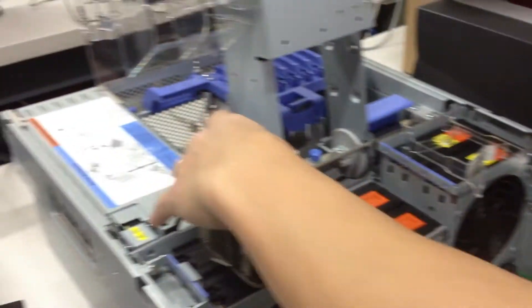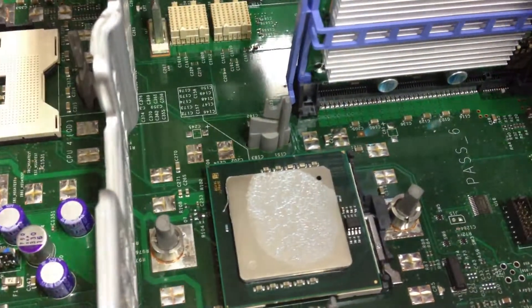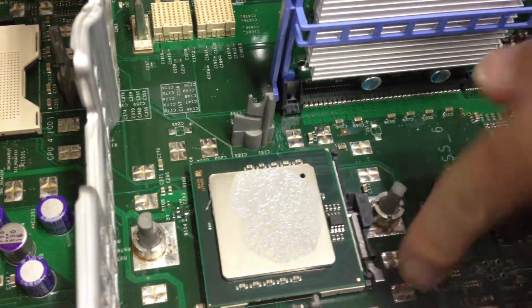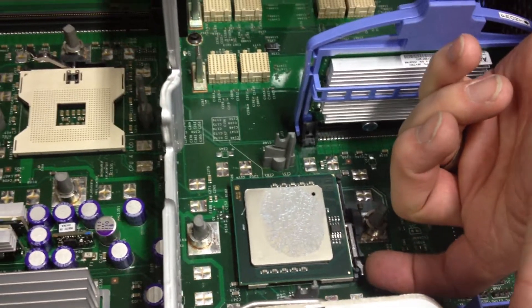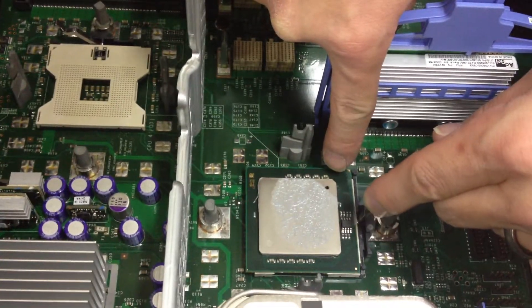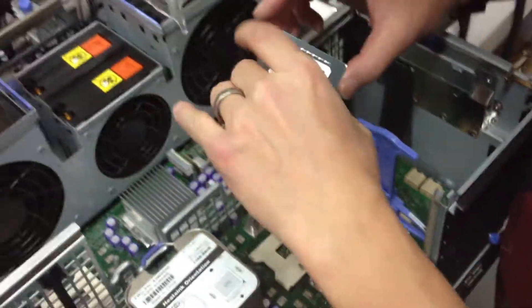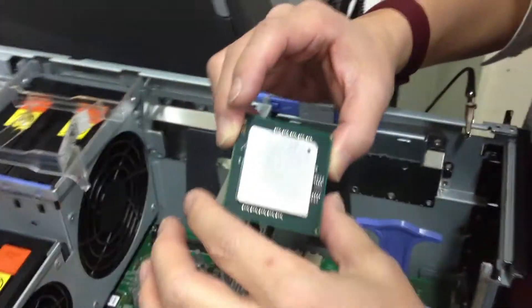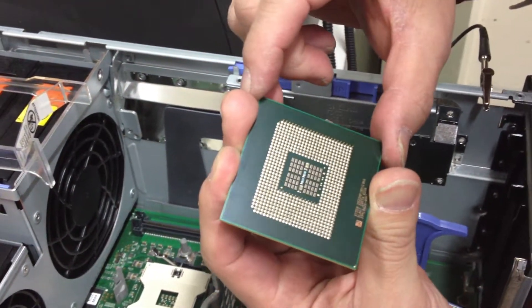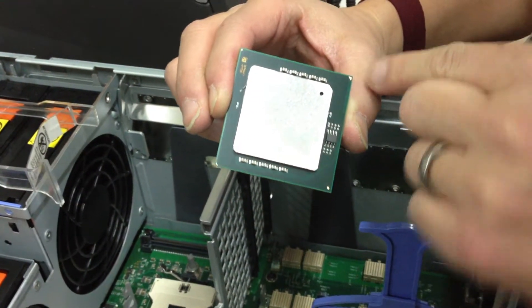Here's your heat sink. Remember to put it upside down because there's gel. There will be a lever — you can see this little thing that looks like the state of Florida. Pull it up and at the end you'll see the CPU shift as you go all the way up. That means you can now take it out. There's your CPU — then you would replace it. Be careful that the pins are all nice and straight. You can see a triangle in one corner here that matches the triangle down there.